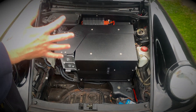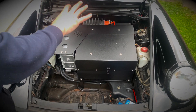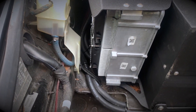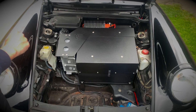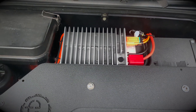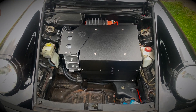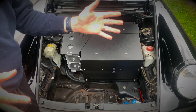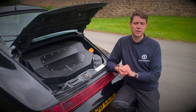But the vehicle would not work without it. This is part of our 54 kilowatt-hour battery pack — there are a number of modules inside that box. It's also mated with our 6.6 kilowatt charger on the side, for home charging, with the charge port in the original petrol flap for convenience. We've also got our DC-DC converter — the equivalent of the engine's alternator — and the HVAC system is behind that just under the dashboard. There's also the standard original 12-volt battery, and there's still some decent storage space.